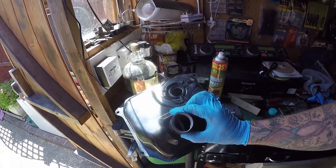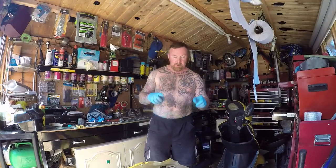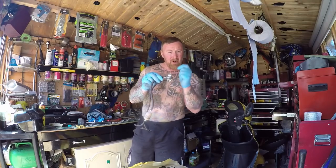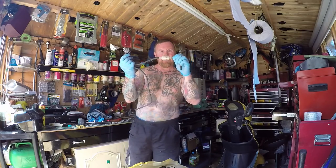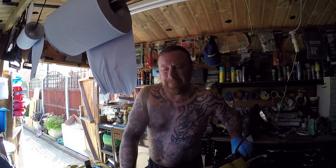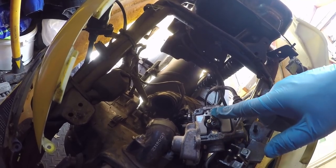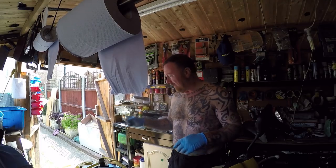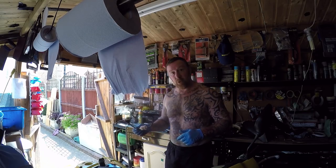We now have a very clean petrol tank — and some very crap muck in there. Even a leaf was in there as well. Petrol tank back on. The filter was actually inside there, couldn't get it out, so I've cleaned it all up and blown it all through. New fuel line in there — lovely and clean. Not doing it on the hottest day — 33 degrees in this shed. Tank back on, not all the covers. Carburettor — just undo these two screws, turn upside down, idle jet, main jet and so on. Take them out, spray them up — really worth doing. There's that much crap in the tank it could have got through that little filter into the carb. There's bad fuel in there — clean it out.